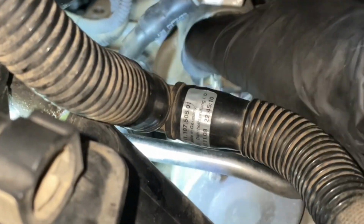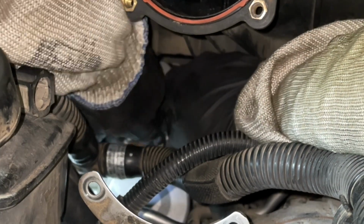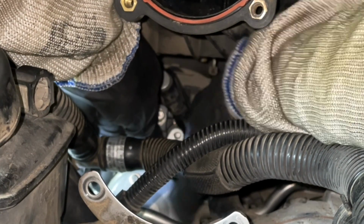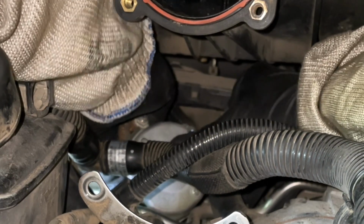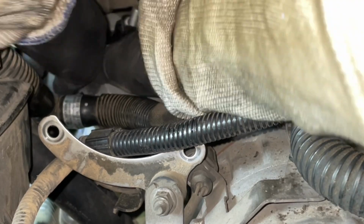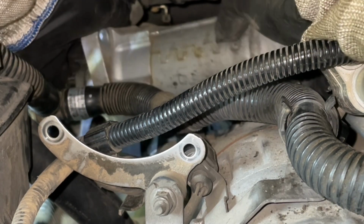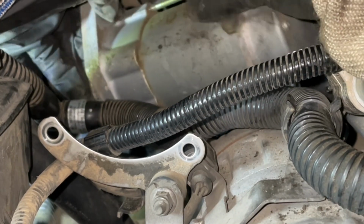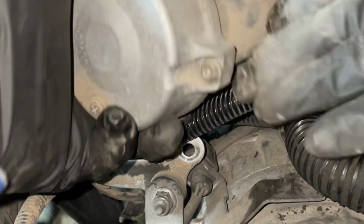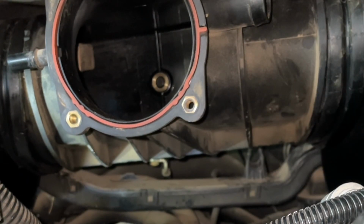All right, I've got both bolts out. You can see the starter back there. It is loose now. I wanted to try to document how I actually get it out because there are a few barriers. The first thing is kind of tilt it up, I guess, once it's pulled out of the flywheel. There we go. Yeah, so far looking promising. Yeah, there we go. I did it. That's it. Successfully removed the starter without totally removing the plenum. I am happy about that.